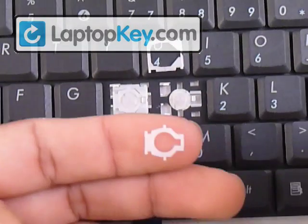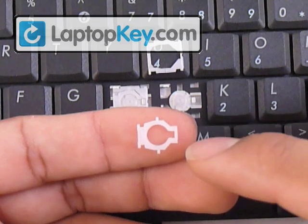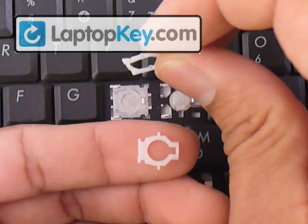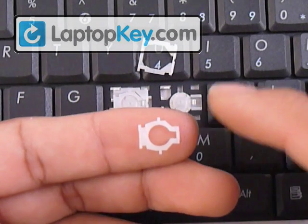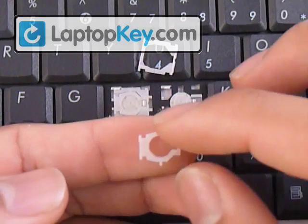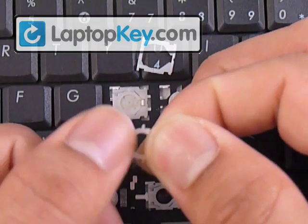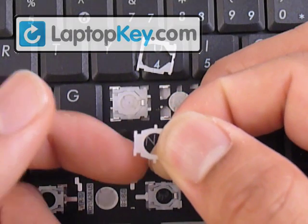Get the next piece. You can see that this one has two pins on the left, and the pins in the middle are going to click onto the holes in the middle of the larger piece. This bar to the right is going to go underneath the large metal hook. Make sure not to put it upside down either — feel this part: the left has to be one smooth part on top. If you feel a gap or discontinuation, that faces the keyboard.